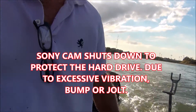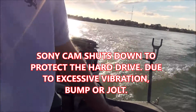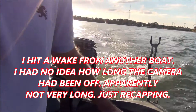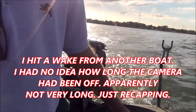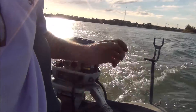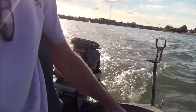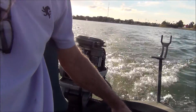What was happening was I was hitting, opening up the throttle, and it kept choking out — choking out like something was stuck in my high-speed jet. So I opened it up, pulled the choke, tried to suck anything out that was stuck in there. And it did it a couple more times, and I think it may have smoothed back out. I've been screaming the whole time, man.